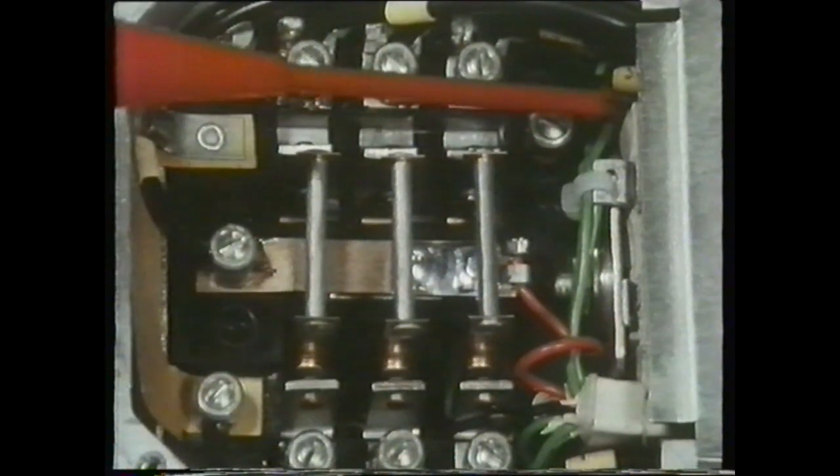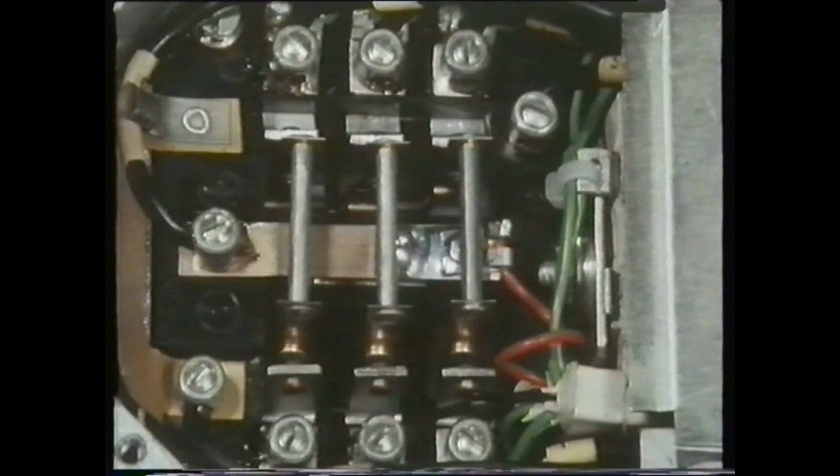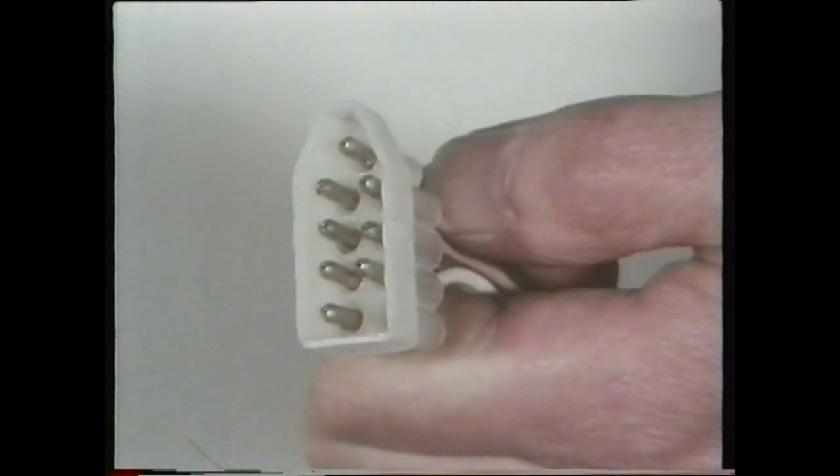On the underside of this change speed unit, the two-speed protection device is situated here, and beneath this cover are the electrical connections of the unit. If a flow of current isn't available to the EP unit plug, check that all of the wires and connections here are secure and that there are no signs of corrosion. Also, operate the change speed unit and ensure that the contacts are indeed making contact. Then, on occasions when the vehicle is fitted with an intermediate connection between the change speed unit and the EP unit, ensure that there's electrical continuity through the connection.